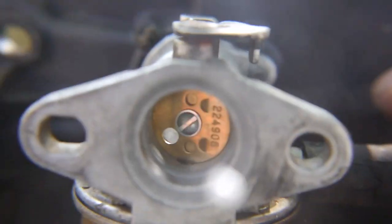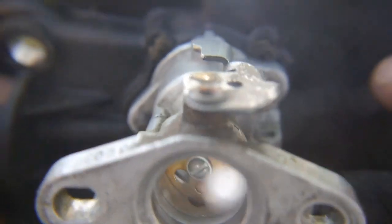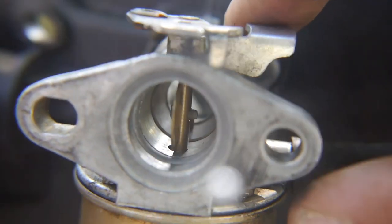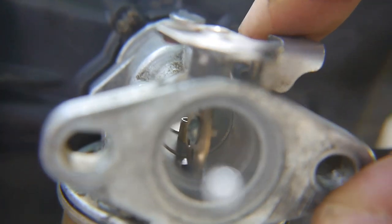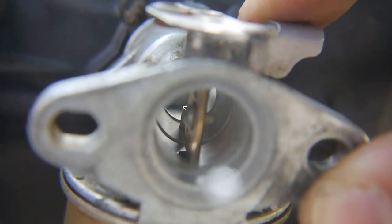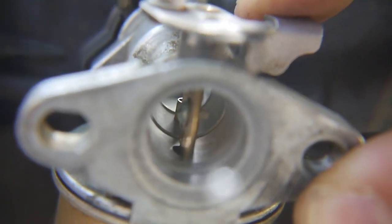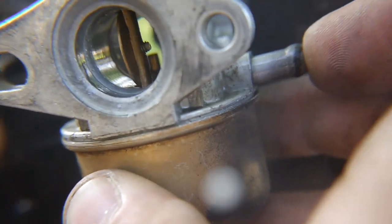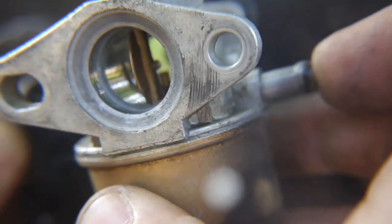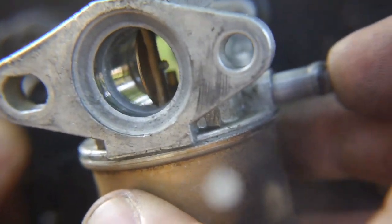Quick explanation for what was wrong: what you don't see is that the fuel line on the right is hooked up to the gas tank like it normally would be, and this works by pressurizing the tank — the bowl underneath the carburetor — which then pushes gas up if there's enough pressure. But if there's an air leak out the fuel side, that pressure doesn't build up enough and you don't get the priming. So when I put my finger over it, that then allowed the pressure to build up in the bowl and for the fuel to come out. I hope you enjoyed this, thanks for watching.